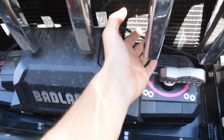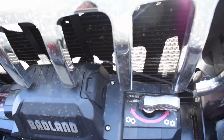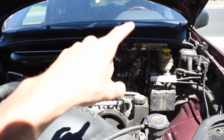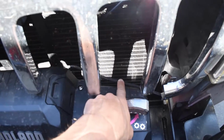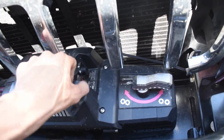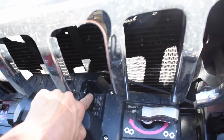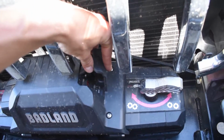Okay, so I did tap into the solenoid here. Thankfully it's only 2 wires that you really have to run in. You don't have to run any power to it. Your power switch is literally just going to power the other winch switch, and then once you hit that, it'll send power through here. I still have access or control to this because I just ran a jumper off of the actual plugs. I don't know which one is which, if it's up or down.